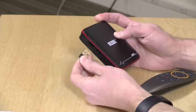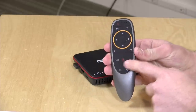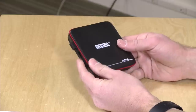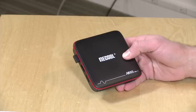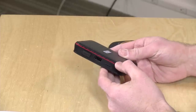You'll notice a little dongle plugged into one of its two USB ports. That's because this does not have Bluetooth built in, but some functions of the remote — namely voice search — require data transmission to work. So instead of a Bluetooth radio, they packed in a dongle, which eats up one of your two USB ports. It also doesn't support 5GHz Wi-Fi networks, so you're only on slower 2.4GHz, which might be a problem for high-end video formats and Netflix streaming.